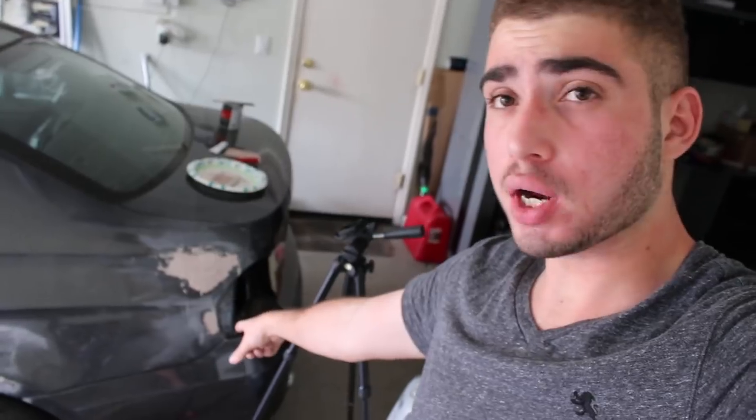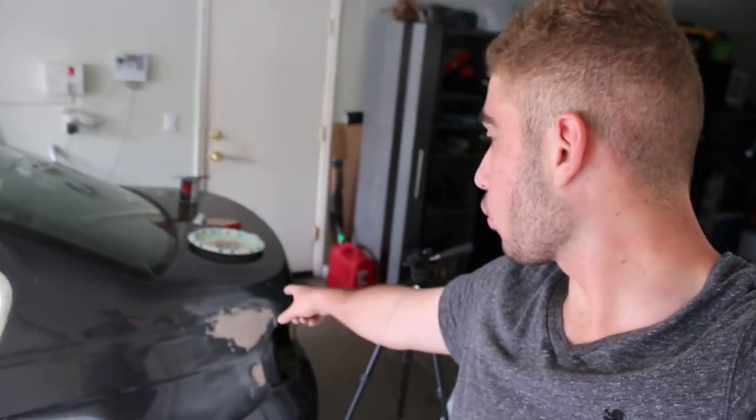As you can see I put the Bondo right there — I'm trying to get the shape right, so I'm gonna have to work at that a couple more times, keep sanding it down, bringing it back up. That part I'm pretty sure I could finish — which is the second bullet. So one bullet: the second is probably fixed on this second try. The third bullet's already got fixed on the first try. Two more bullets I believe I could patch up real easy. I'm gonna give it about a solid hour for it to dry. The one up here I'm gonna try to get the best shape I possibly can. This is gonna be my show car — I want it to be really nice. I don't want to use so much Bondo like last time, because a body shop guy told me the Bondo should be no thicker than like a hairline — a centimeter at most. The Bondo is not meant for a giant indentation; you've got to bring the metal out first and use the Bondo just for the little gaps you can't pull out.